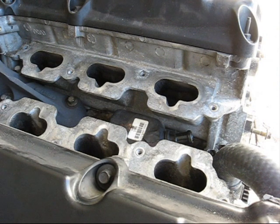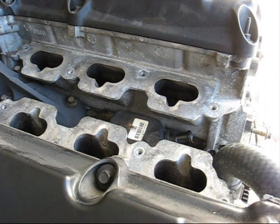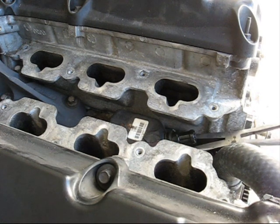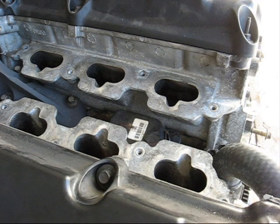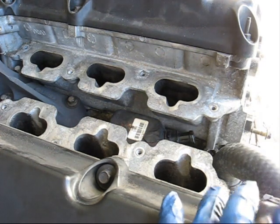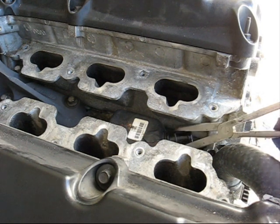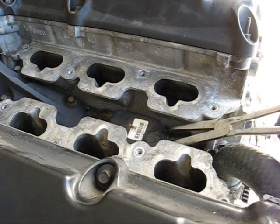I'm getting ready to install the intake but before I do, I've got a new PCV valve I'm going to install. These engines are known for PCV valve failures, and if the valve fails in the open position the engine will start consuming a lot of oil in a very short period of time, and if unchecked that can actually run the engine out of oil and cause major engine damage. So just as a precaution I'm replacing the PCV valve. I recommend using an OEM PCV valve anytime you replace one, because the aftermarket ones simply often don't work that well. PCV valves, even the OEM ones, are really cheap — this one's a Motorcraft, which is the OEM manufacturer for Ford, and this one was about eleven dollars. So I'm just going to pull the old one out and pop the new one in before I put the intake on.